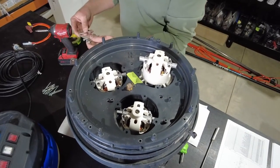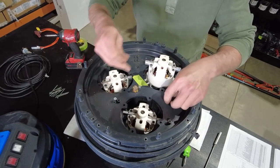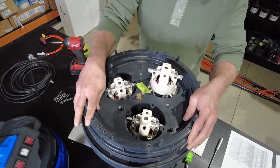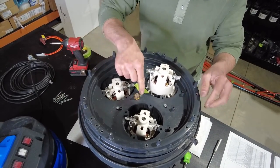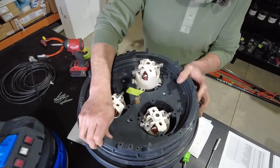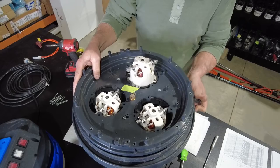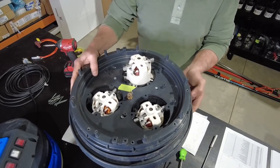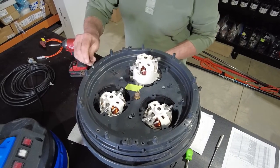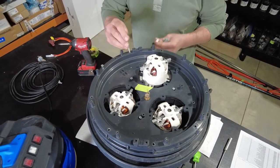Another big tip and trick is don't do up all your screws until you've got everything started, and as you do them up, do them evenly to pull the whole casing down evenly. Remember, the longer screw is to the center. And just keep an eye on your mixing lever to make sure that it is moving freely. The same length screws go around the outside. Earthing screw, non-countersunk.